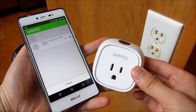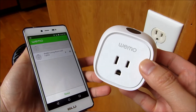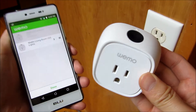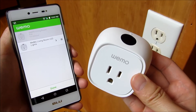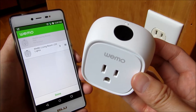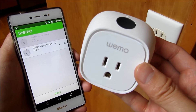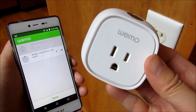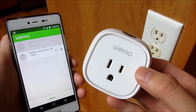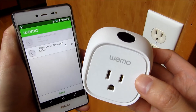Before I reset this Wemo and reinstall it from scratch, I want to talk about how this Wemo installation actually works. This Wemo device is actually a Wi-Fi hotspot in itself. You're going to use your phone and connect directly via Wi-Fi to this device. Once you connect, you set up the Wi-Fi password of your network into this device, and then this device will connect to your internal Wi-Fi network. What's tricky for most people is they don't realize that this Wemo is a Wi-Fi hub itself and you have to connect to it in order to program it directly.